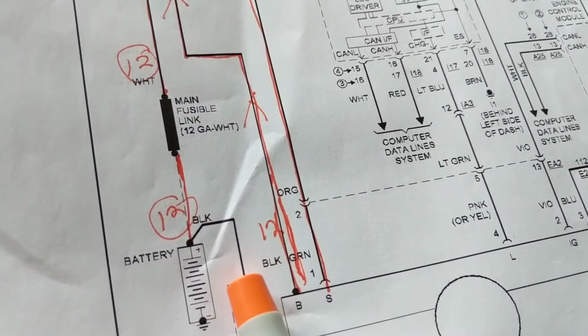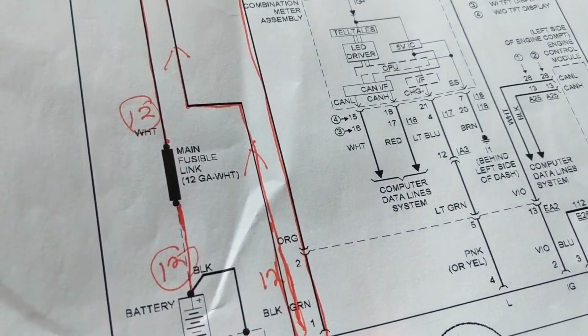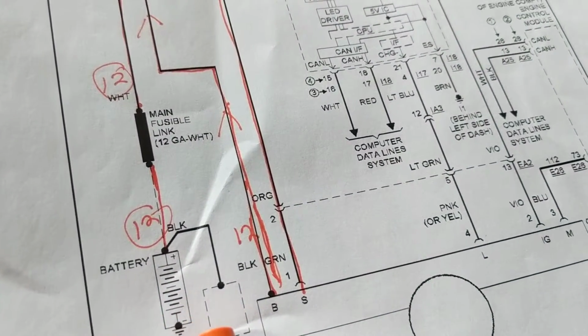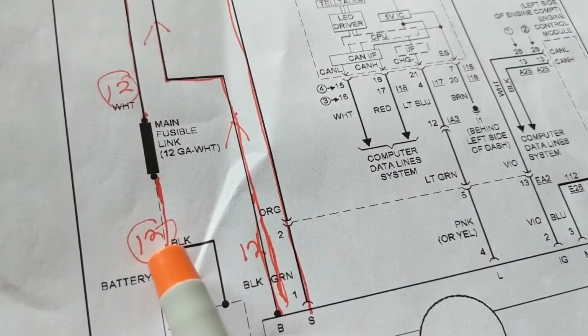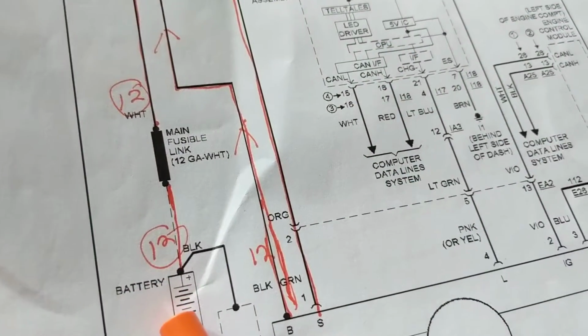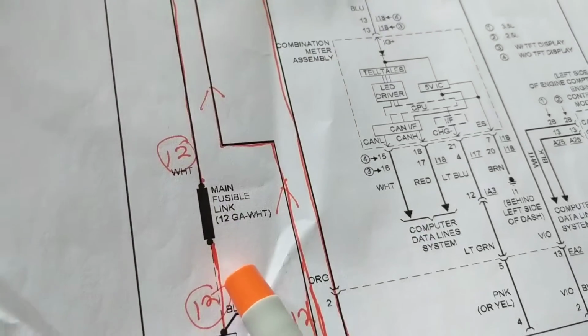If I see 13, fine. I know this fusible link is intact, and chances are the alternator is good. It's the fault of the battery. If I come over here again and crank it, I get 12 volts. I leave my lead over here and I get 12 volts. I crank it, right? And guess what happens? I get nothing over here after that. There must be something open.